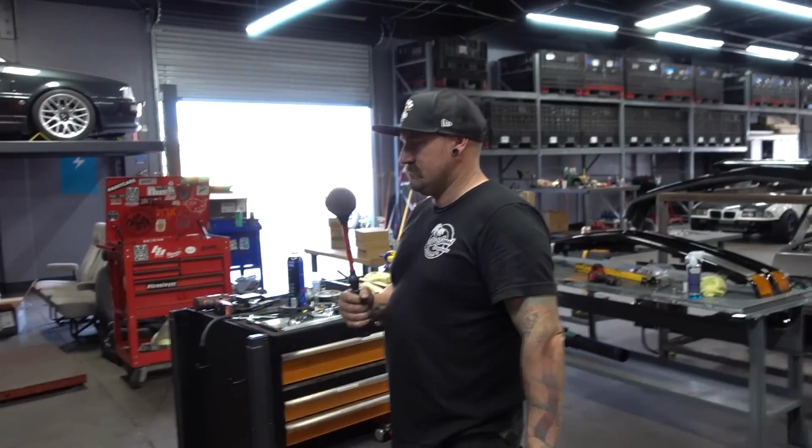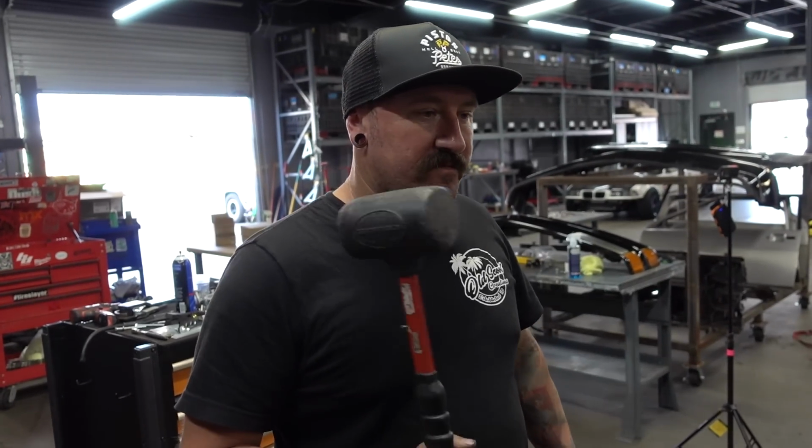So what are the next, that's a hammer. What are the next steps here? Cut out some plate on the plasma table for these mounts to go onto the chassis, and then weld them onto the engine, modify the trans cross member, and pretty much do them burnouts in about 2 hours. Oh, sick, perfect. We're gonna be done. This is great. Love this.